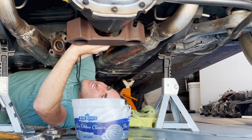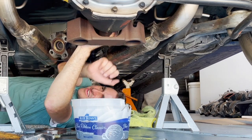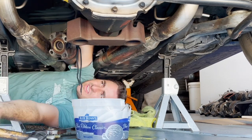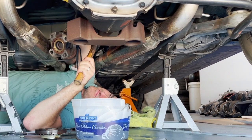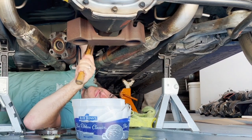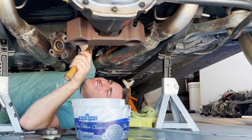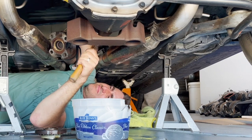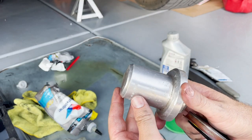Here's a little video of me in there. I also took the driveshaft and tied it to the exhaust so it wouldn't be dangling and I didn't want it to come out and leak transmission fluid up by the transmission. I just pounded the seal in and it drove in nice and straight. I did not use any extra RTV on this — some people do, but that's just what I chose to do and it's turned out great. I added fluid to the point where it was coming out and now it's all finished.